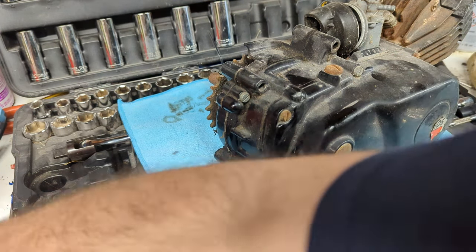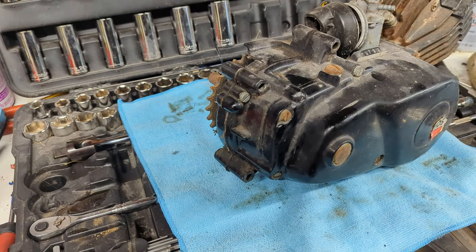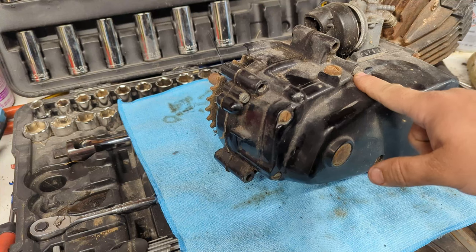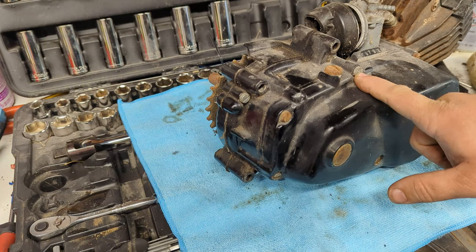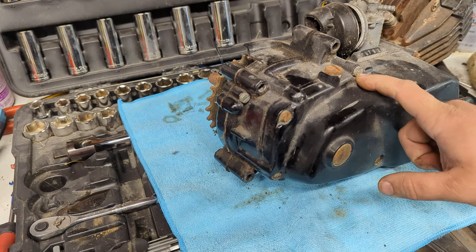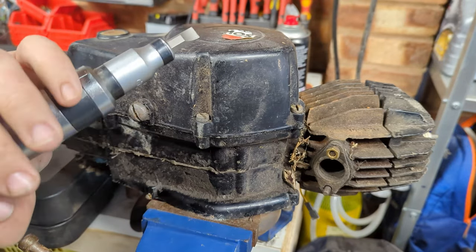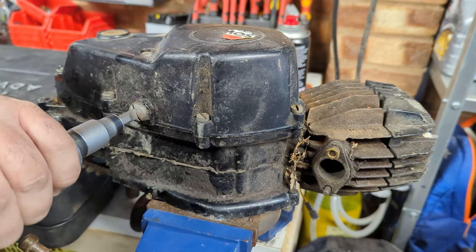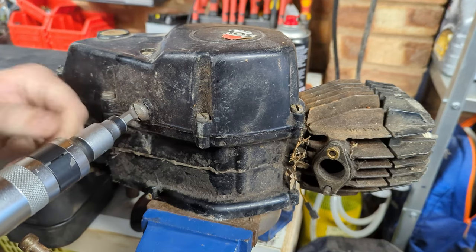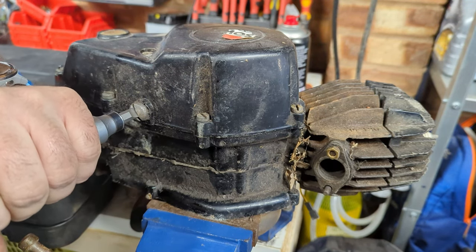But what I did find was my impact driver, which would help us out with these screws because these are cheese headed, at least they were on the other bike. There's a strong chance that if I go at them without a little assistance, they'll just fall apart. Okay, first up, let's see if we can loosen up the screw. I'm going to pop the impact driver in here, and I'm hitting it with a rubber mallet so that I don't destroy my ears.